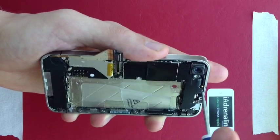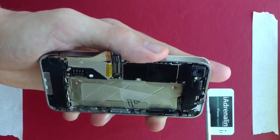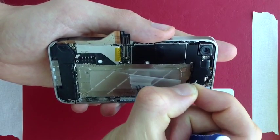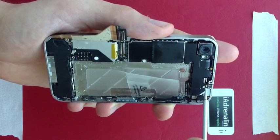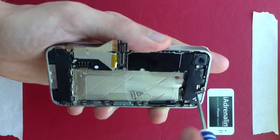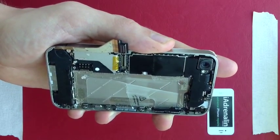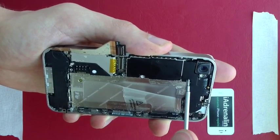Your Wi-Fi signal actually goes through that screw into the motherboard, so it's very important to have that screw in place. It's quite a long one, quite a big one, so definitely don't lose it. Some screws you can do without in the iPhone, however that particular screw you most definitely want — without it your Wi-Fi will not work properly.